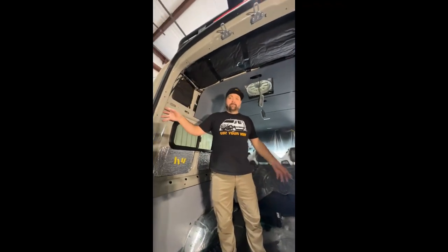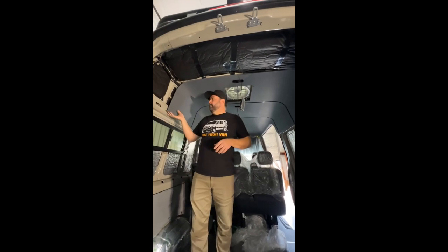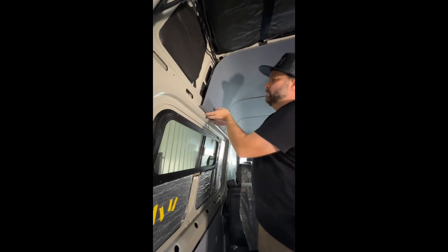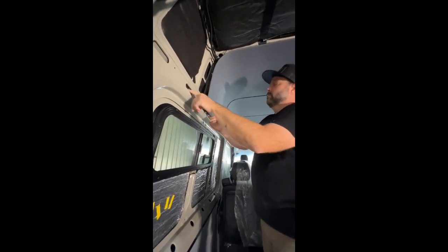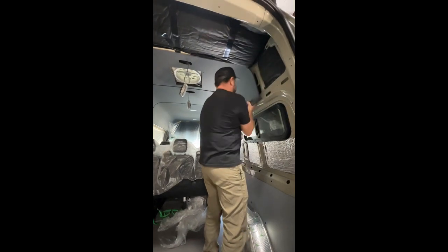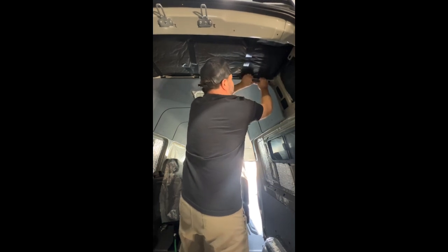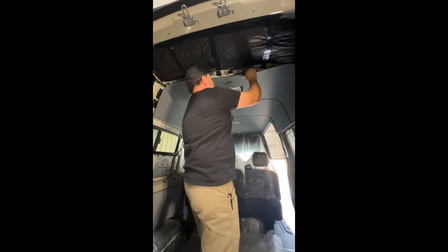Once all your cladding has been pulled off and body clips removed, we've snapped the rear first panel out of the way to show you how to get the continuous ones snapped out. Lights are dropped out, and if you have a fan, pull the fan shroud off. Basically, there's a part of the headliner that snaps into these oval mounts here — you lift it up and pull towards you to snap the clip out of this oval hole. Do that on both sides carefully so you don't break it. Then go through and pop the headliner down from up top — it has plastic clips, just give it a good solid tug.